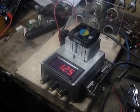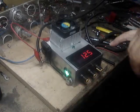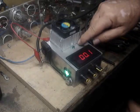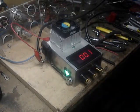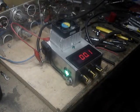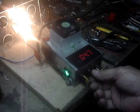Right now the master switch is lit up, so you know it's working. You're going to wait one minute. We've got 12 volts and 0.1 amps right now, and your little LED is not on, your fan's not on. Probably about 50 seconds before it comes on. There it is — it came on. Your fan's on, your green LED's on. And you can adjust it right here — you can adjust your duty cycle, adjust your amperage, and you can adjust your frequency.